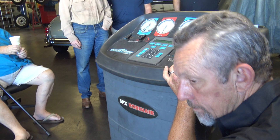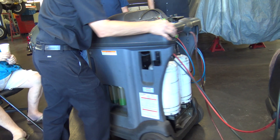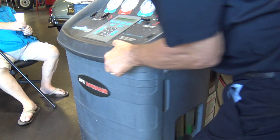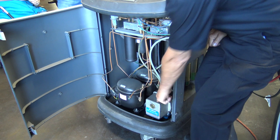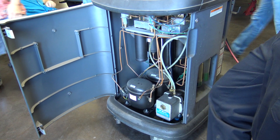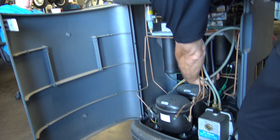What it does is it filters it. Let me open this up so you can see the workings in here. I'll turn this around so you can see — there's two reserve tanks right here. One is R12 and one is 134. In here you've got two separate systems. You've got one vacuum pump — you need a vacuum pump to pull it out — and then you've got two other pumps right here. The vacuum pump is to suck the air out of the system. These are pumping the Freon. It's got two filters.